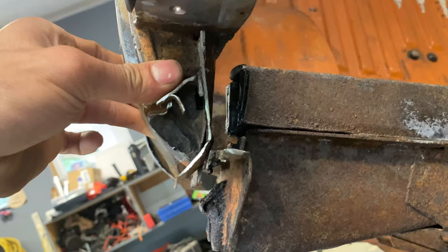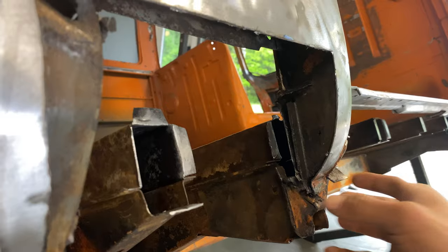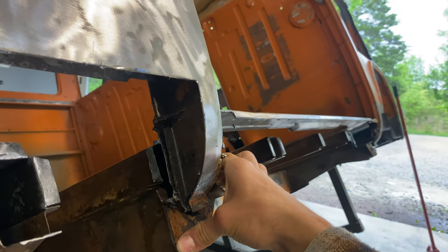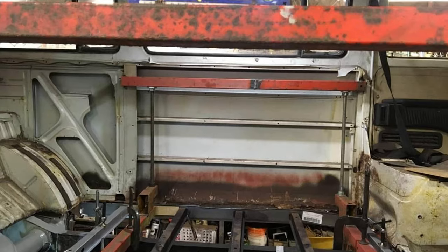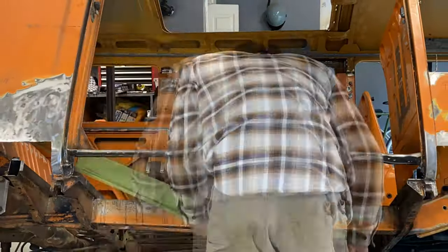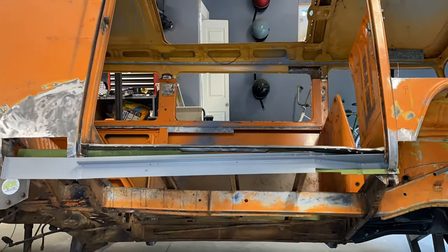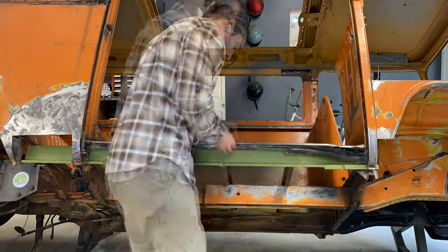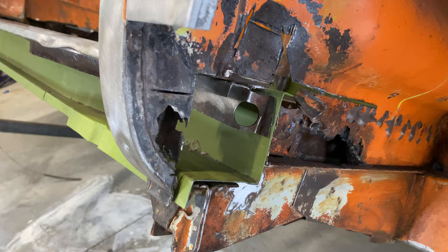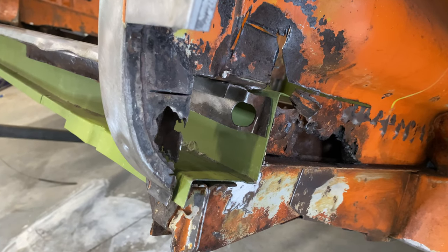It just warms my heart to know that that rust is gone and hopefully gone forever, because I plan on taking care of this bus. At this point the C pillar is completely disconnected from the middle rocker, so it is essentially floating. Some people brace their frame before they do this — I did it, it worked out fine, but that's on you. Now it was time to start test fitting the inner rocker, and the way I get things to fit is I put them in, take them out, put them in, and take them out again. I put the top track back in place to make sure it lined up well with the inner rocker, as I didn't want to weld anything just yet.